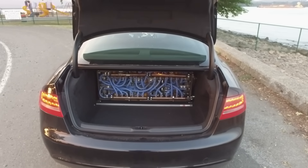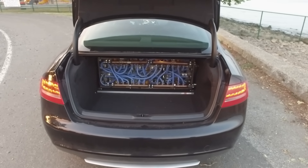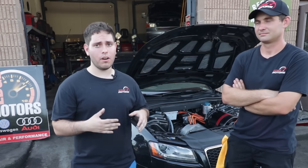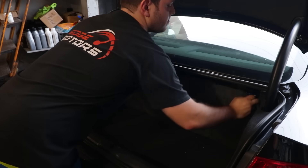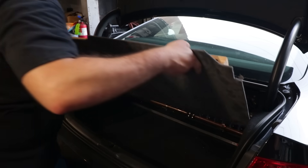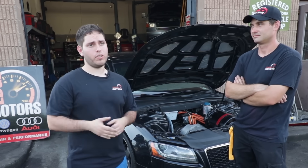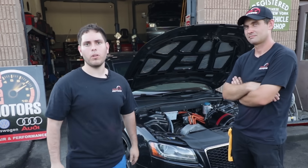That prevents it from dumping heat from one battery into another. Within each brick of the Tesla Model S batteries, they already have two embedded thermistors that tell you the temperature of each battery brick. We have an integrated battery management system that sees all the values — you basically just program it so that at a certain temperature, say 30 degrees Celsius, it activates a relay that activates a pump to go to the radiator and manage the cooling.